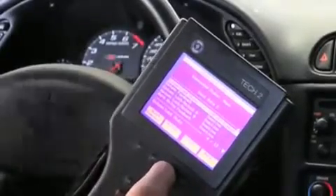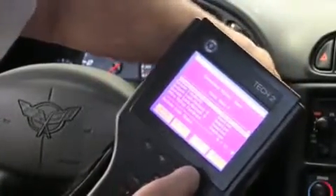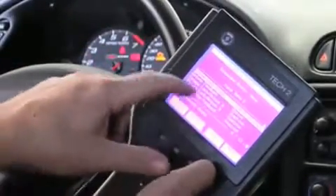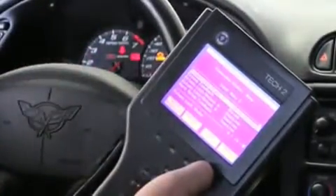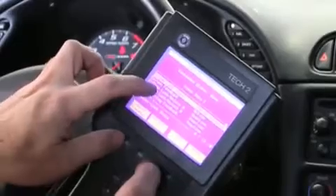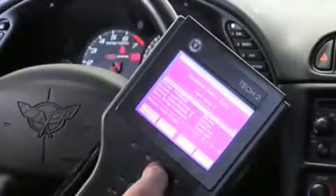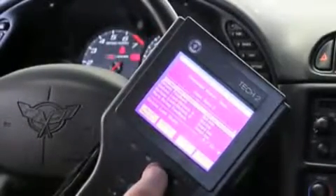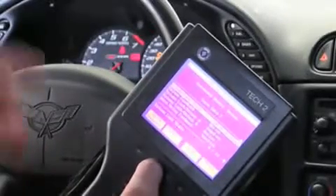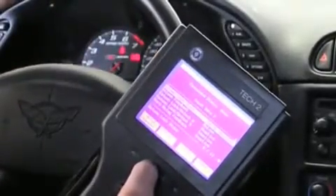Just something to be aware of. I'm going to go ahead and install the key and turn the key on. You see it says ignition on, unlocked, column feedback active. If we try to lock the column, you'll see just one of these actuator states change. You can also hear the relay change states. And unlock. You do not see the column feedback change, you do not see the column lock state change, and you do not hear the actuator change.